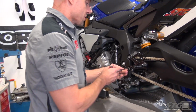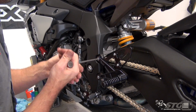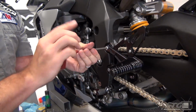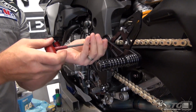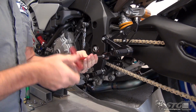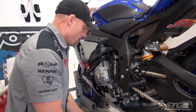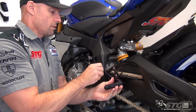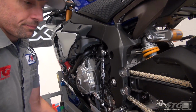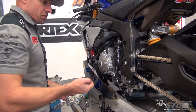We'll begin with a footrest, low-hanging fruit here. The way the R1 is set up, we are using the kickstand mount down here to hold the shifter. That's the way they do it from the factory, and that's the way the kits that we've installed thus far are designed to just move that forward. So super easy here. Once again, back to stock hardware.